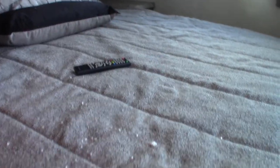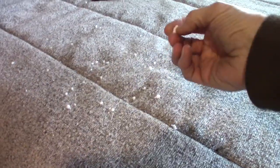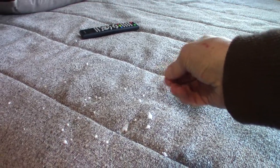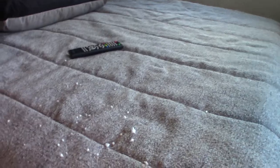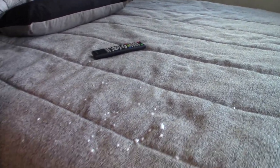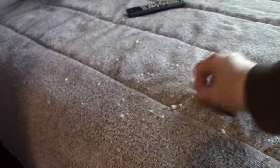You'll sometimes get this stuff coming out of the air conditioning vent, and the fan goes through there too. We always call it snow, but it's just styrofoam from the styrofoam ductwork. After a while it won't come out anymore, but as you bounce down the road and use it, there'll be a few times when you get a bunch of this stuff coming out. No big deal.